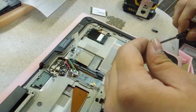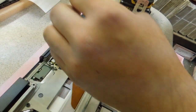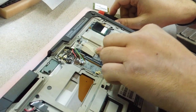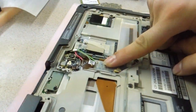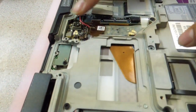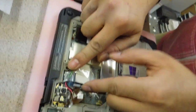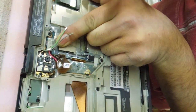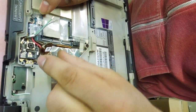Now for this, instead of leaving the cables just swinging around, put that screw back in. There actually is a place for them on this board here, but to get to it you have to take out this ribbon and slip them underneath. Pull those two to the side. This little connector has a little switch on the back — it's very tiny, so you've got to be very careful. Just flip that up to release it. Ribbon comes out.